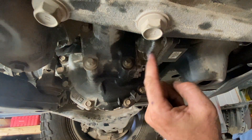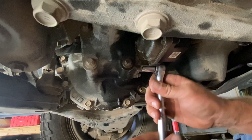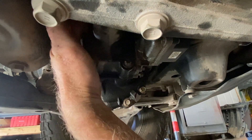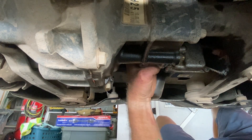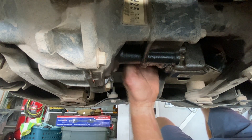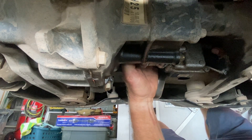The ADD actuator - I had it off the other day and it's a little bit of a pain. I read about folks who had to drop the diff a little bit to get to it. I was lucky enough to be able to get to all four of these 12mm bolts pretty easily. You can kind of get your hand up in on top of the diff tube to get the top two and slide this thing out with a short 12mm and a ratchet. You can go in between the pan, feel around for the passenger side top bolt - that's the hardest one to get to. The other three are super straightforward. There's room enough to get a ratchet in here and move it - without the skid on obviously.